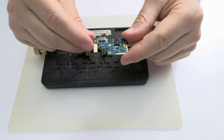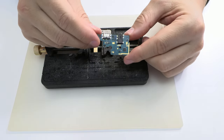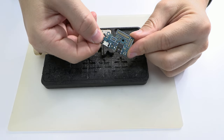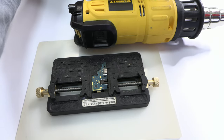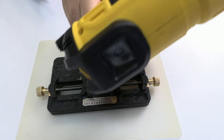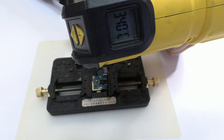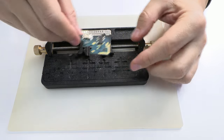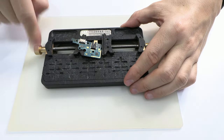And to make things more complicated, we are going to replace it with the help of a hot air gun. The air temperature that we are going to use is 340 Celsius degrees. So there are no excuses for tool defaults. A hot air gun from AliExpress is very cheap, even less than $10. I'll try to leave in the description some links from where to buy it.